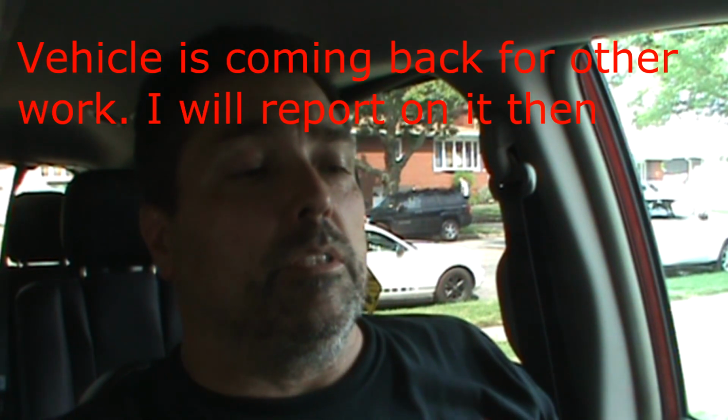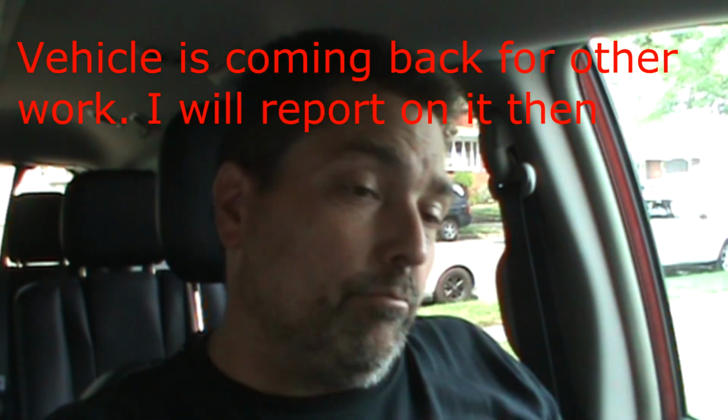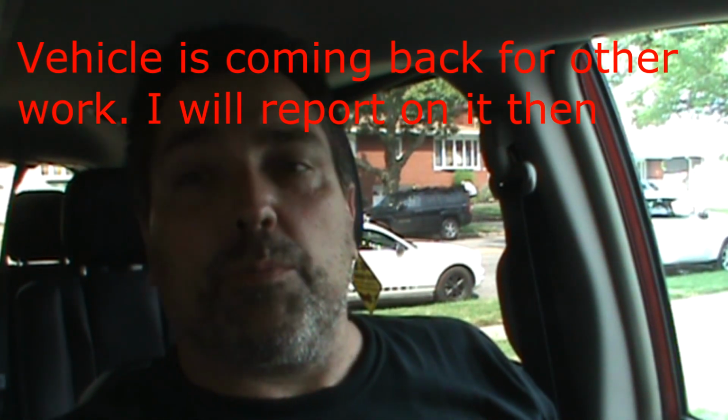If there's anything strange that comes out of this... where am I? I'm over here. Oh, fumble. Is that better? It's a little better. All right, I'll road test it. I'll look into that ambient temperature being 68 degrees and kind of stuck there. I don't know if I quite understand it. It may be irrelevant. I know the temp voltage is good. It's not stuck at 5 volts. And maybe that's simple. Probably when she wrapped the bumper, she snapped the sensor. It was broken. The bumper looks like it's been manhandled. Sometimes obvious works.